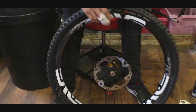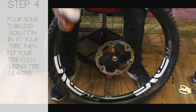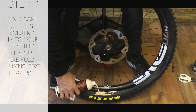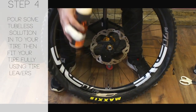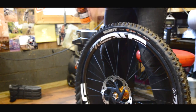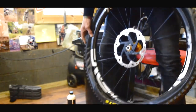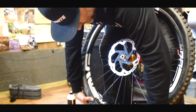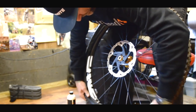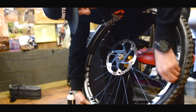Leave a bit of the tyre open. Get your tubeless solution and rub it in. You will need a little bit more than normal with this because the Huck Norris tends to soak some of it in. Put your tyre bead into the middle all the way around to give yourself a little bit more room, then push it in.